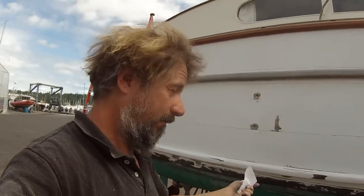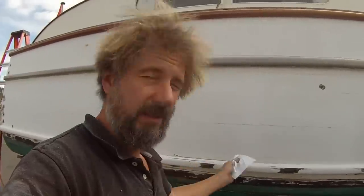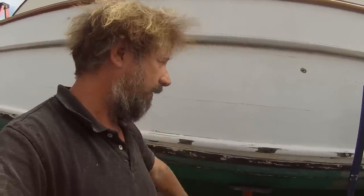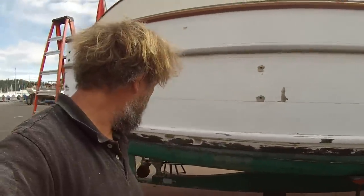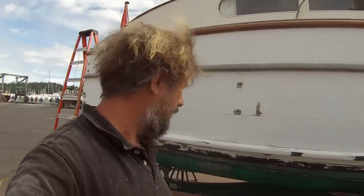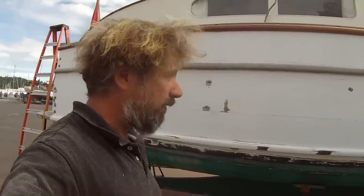What they did was just pack it in a few spots. There's still a lot of old hard white paint in there that's just dry and brittle and not doing much. I don't want to do anything too permanent here because we are going to fix all these ribs, and eventually that will come fair again. I don't want tight caulking in there to make it difficult to straighten that out — I'll have to reef these out whenever we do that. So I'm probably just going to tighten up the caulking, the cotton in behind, a little bit — make sure there's plenty in there — and just put something over the top to protect the cotton, but tolerate maybe a moderate amount of leaking in the meantime.